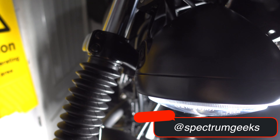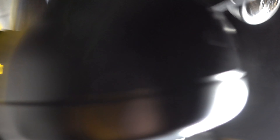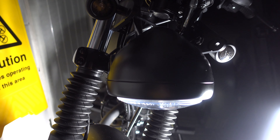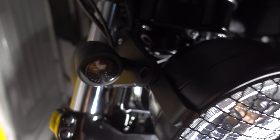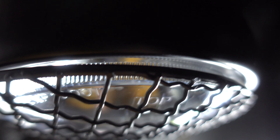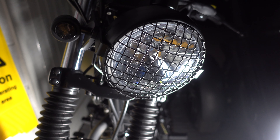When putting it all back together, make sure it's clipped in quite nicely — it should be even all the way around. As I mentioned when taking this apart, one bolt felt a little bit weak, which is why I mainly put the thread lock on. Just be gentle — there are only two bolts holding that whole enclosure together. Slot this back in — there is a compression fit — and make sure the holes line up. There should be a little gap going through here when finished so you can get a cloth through to clean it, and then we're nearly ready to complete reassembly.